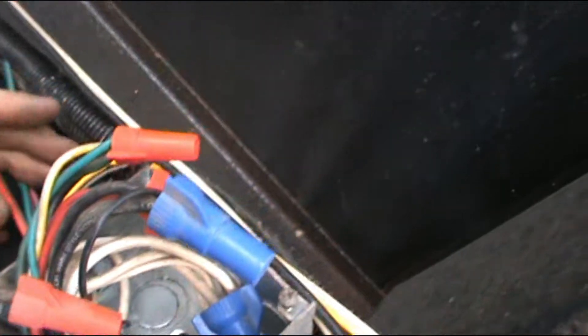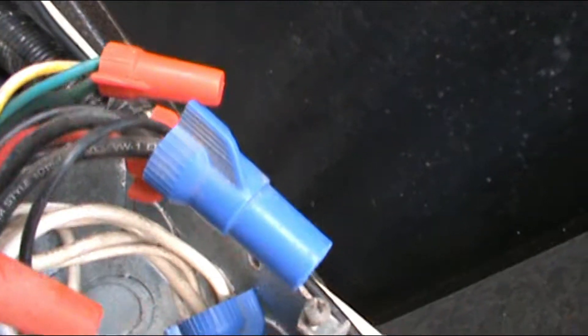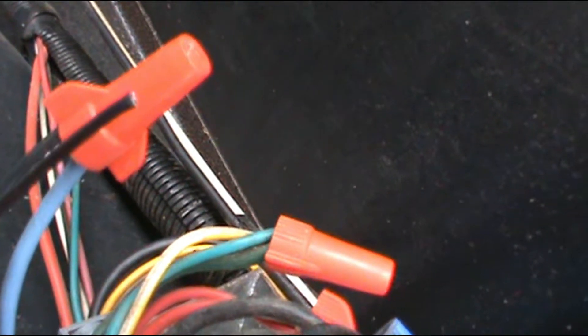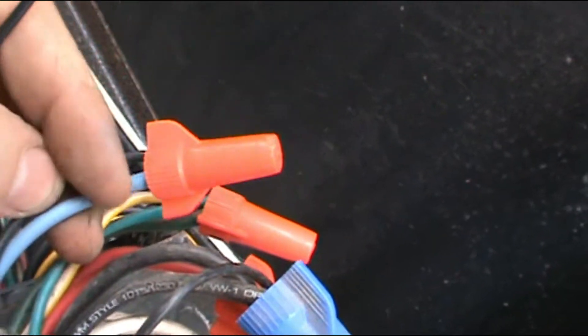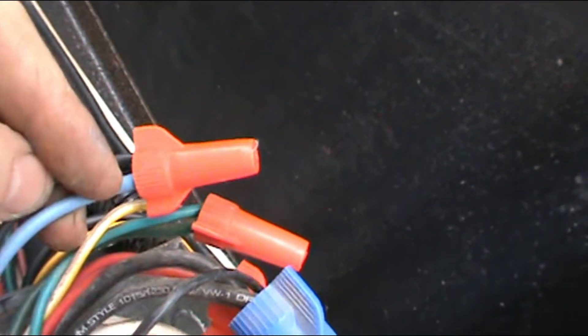Anyway, the first wire was hooked here — I've since disconnected it. That's this wire right there. And the reason I know that is the blue wire off your trailer plug is your brake wire, so this connects to the brakes, because this is coming from the trailer.